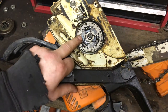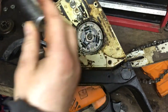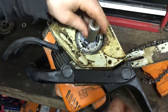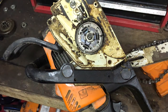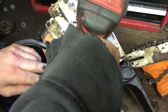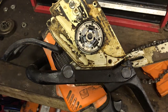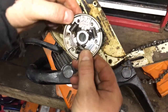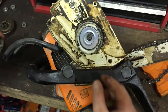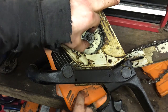Let's get the impact and get this clutch off and we'll have a look at the pump behind, make sure the pipes aren't split. I'm using a 19mm - in the States it'd be 3/4 inch. This is clockwise for removal. There's the clutch off - it seems in good condition, springs look nice. One of them is going a bit rusty, and then you've got this back clutch plate.